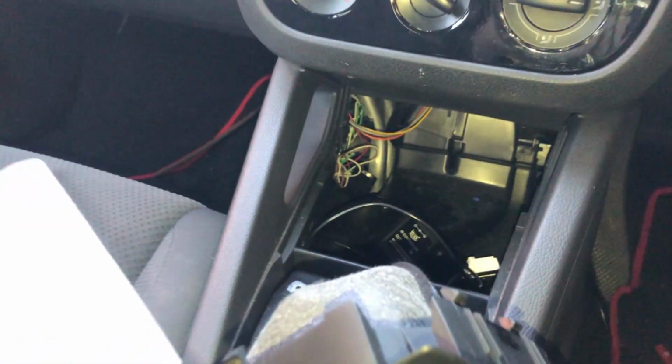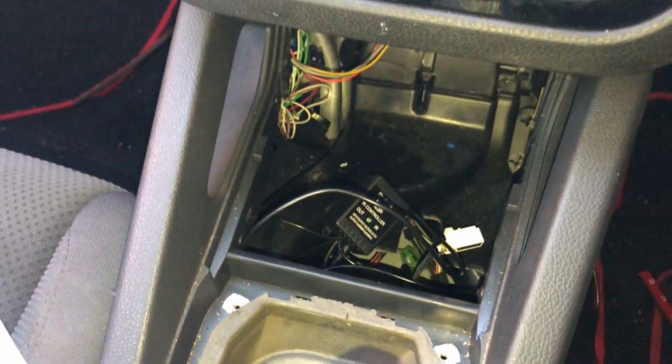So after moving the seat forward, what I did was I ran the wire across the rail. So if you look here, you can't really tell, but the wire, I fed through this little gap from there and around in through here. And I've actually fed it inside of this bit just in there. So that way, when I move the seat forward and backwards, it doesn't interfere with the wire. So now I can get on with splicing into the power.